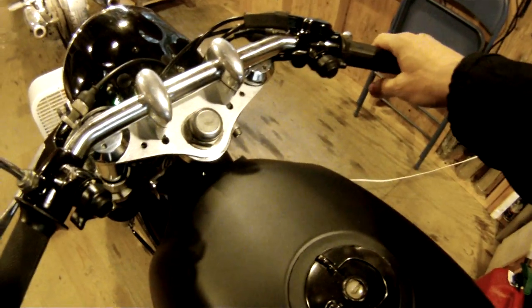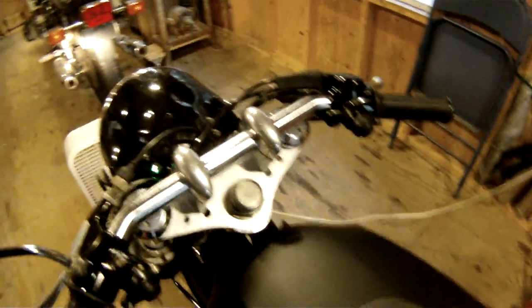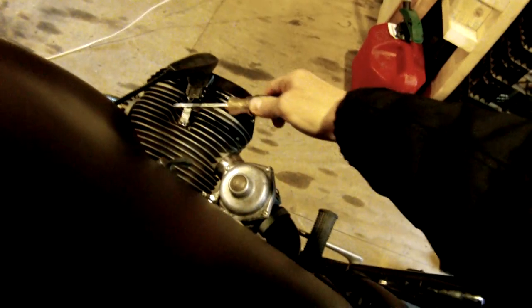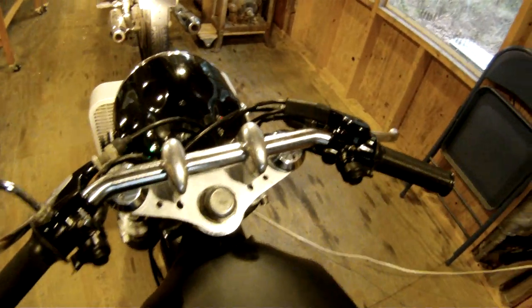It's right on the edge where the gen light comes back on — well, it's not going to come back on. I've got the shorting adapters in place, so what it should do is as I short either side, it should bog the engine down roughly the same amount. Gen light is on.